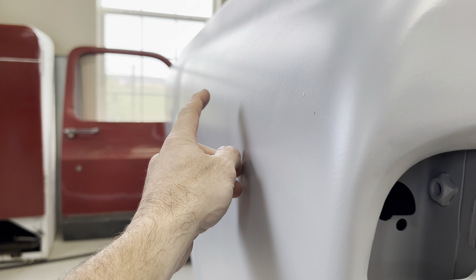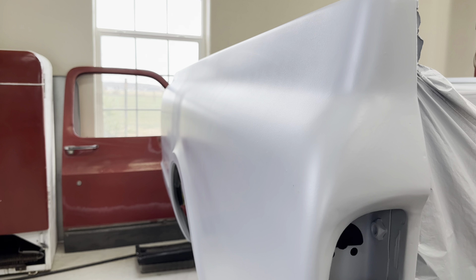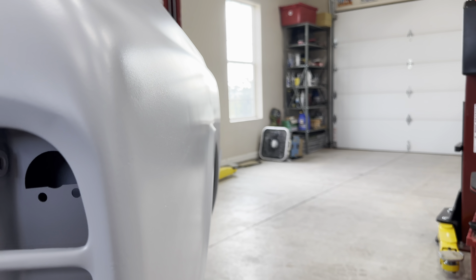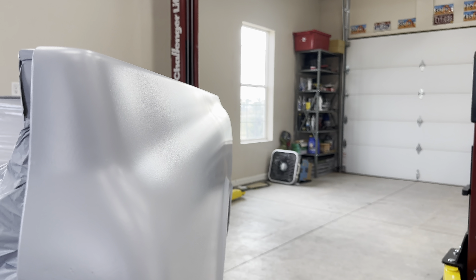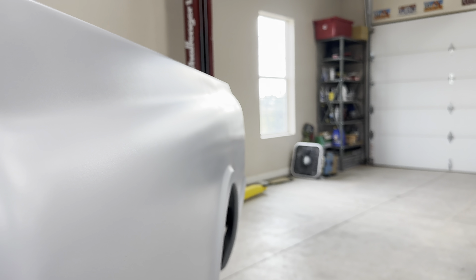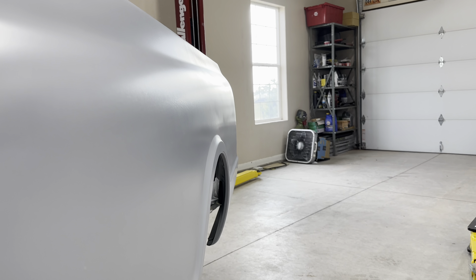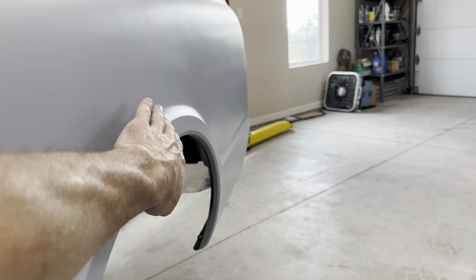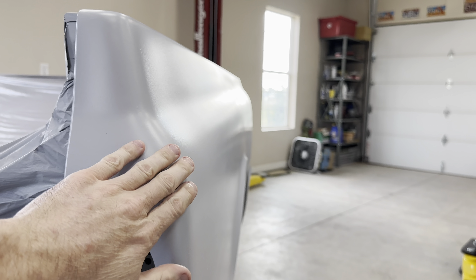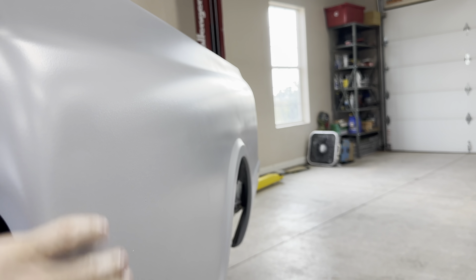There is a low spot right there, but other than that I'll probably be able to sand this off, do a second coat, sand it off, and this side will be ready for paint. Rotating this side around into the light — this side ended up pretty good too. There is a low spot right there, and what you see in this general area is just the light on the way the primer is sprayed. There aren't any actual high or low spots right there; it's just showing up on camera more. There might be one low spot right in this area, but considering the amount of bodywork, it turned out pretty good.